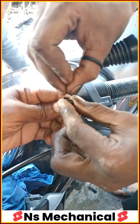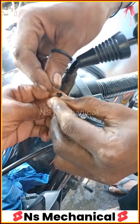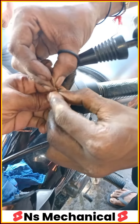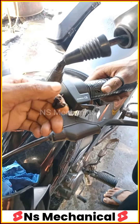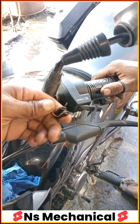Look at these two connections. What will happen? There will be no fuse, there will be no problem. In the old model, the bike was stuck in gear and the self-starter would still work. But now there is no such chance — it's not that it's in gear, it's not that it's on the side stand. You understand that the bike will simply not start.